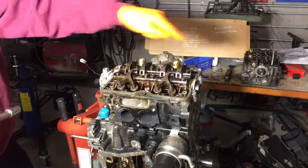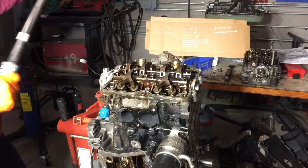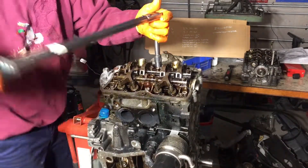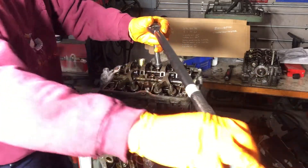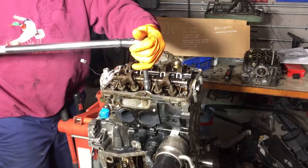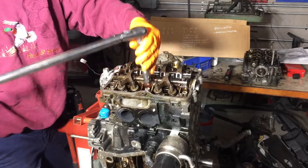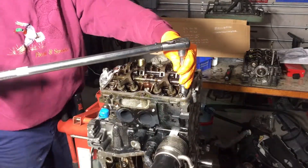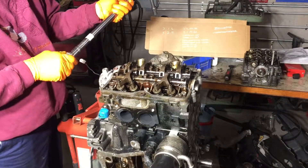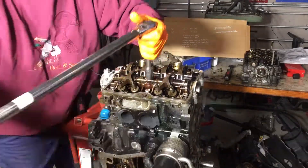One, two, three, four, five, six — and our first pass is 22 foot-pounds. That's kind of light for this big wrench, but this is a big-boy torque wrench, so it's good for way up there. We're doing them all to 22 foot-pounds.